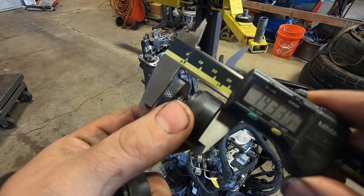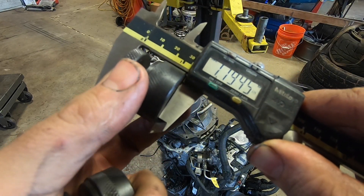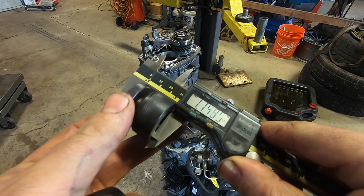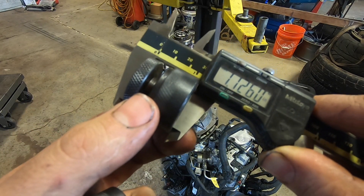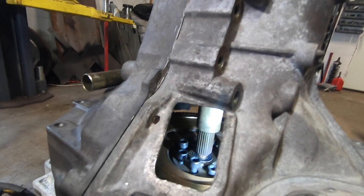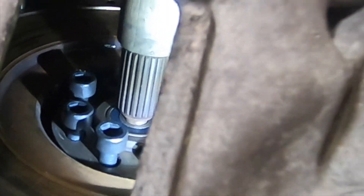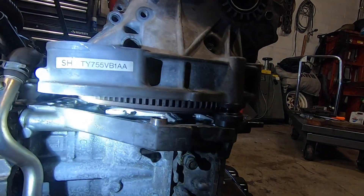Based on my calculations, we're going to need about an inch and an eighth of spacing between the bell housing and the Subaru trans — we'll bring that down to 1.125 inches. We'll put these machinist jacks in there as temporary spacers. Taking an insider view at that pilot engagement — it looks excellent in there, it's going to put the splines right where they need to be. That is a pretty fat adapter plate.